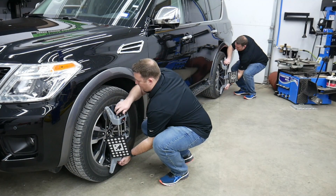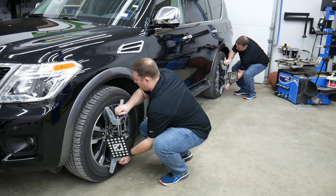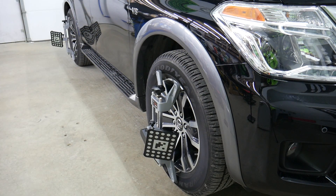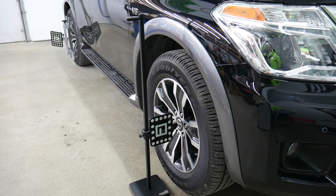In this kit are four wheel clamps to be used on both the front and rear wheels, which also includes wheel-specific targets attached to these clamps. The two rear wheel clamps are used for ADAS calibration target placement. All four wheel clamps are used for the optional alignment pre-check feature.